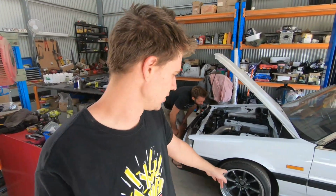So what we're going to do is swap out the steering rack again for a stock one. Like you saw, we didn't have to modify anything on the cross member to fit the R34 rack, so it's ready to accept the R31 rack once again, and the N14 tie rod ends and rack ends, S13 tie rod ends. That way it makes the car pretty standard, an S13-fronted R31 that is easy to find information on and easy to get parts for, and is going to solve the issues we're having with the rack not being quite centered and having to find shorter tie rod ends. It's becoming too complicated, especially for a car that's meant to be on the street. And if it's going to be a street car, it doesn't necessarily need the R34 rack. So we're thinking about swapping the 31 rack back in.